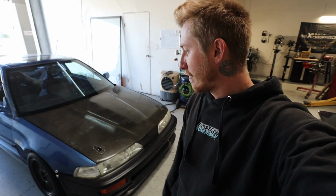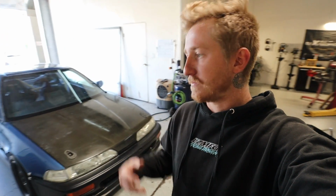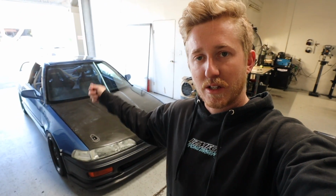It definitely needs an alignment, because I already needed an alignment. So now it's just reiterating that, now that the electric assist is partially countering me on some of the rougher parts of the road. Otherwise it feels really good. The sensitivity works. The only thing is I wired mine straight to my kill switch, so as soon as I put my key in, it's hot. I'll probably change that later just so it doesn't kill my battery if I forget my key in there. The only difference would be when I put my key into my trunk, then my relay clicks, whereas when you turn your ignition on, then it would click, depending on how you set it up.